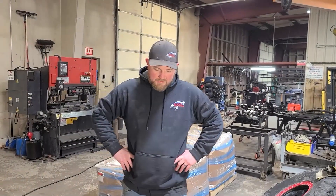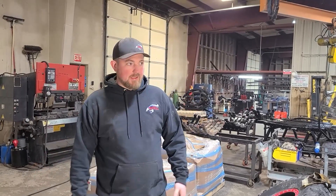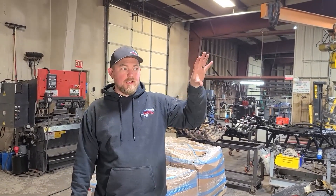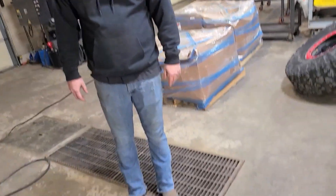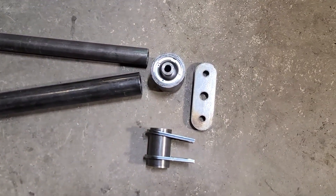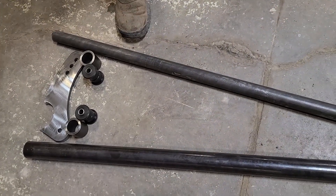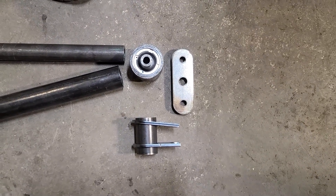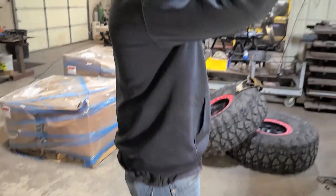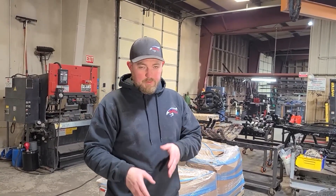Hey guys, Tyler with Alcan Spring, bringing the updates for the new Orbiti anti-wrap bar that we are producing and putting out now. We have the Hemi YJ here set up, getting ready to put the new one on it, and this is the kit that you'll receive: two inch quarter wall DOM lower, inch and a half quarter wall upper, your axle mounts, bushings, sleeves, and then the Orbiti. The Orbiti is the most important part for this setup because the Jeep has all the Orbitis, so we want that anti-wrap bar to articulate just as much as the springs do, so we're putting an Orbiti so that it does.